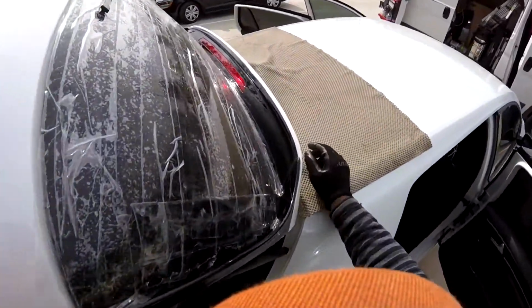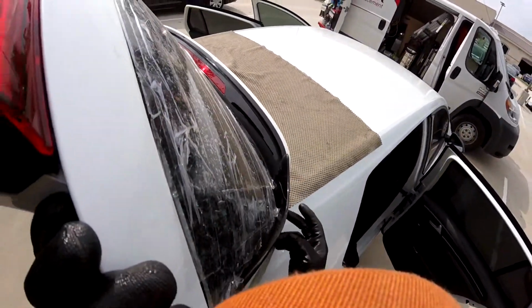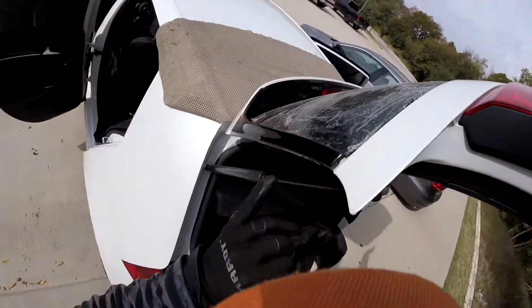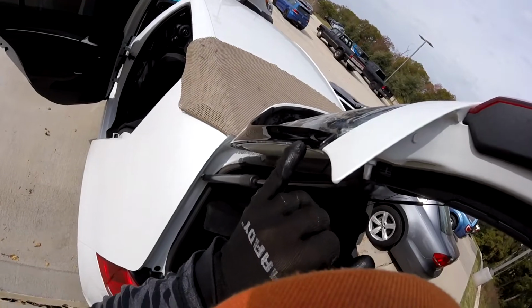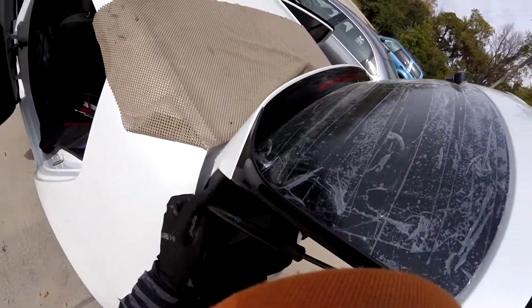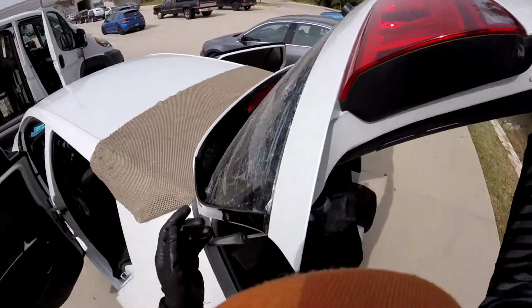Usually the people have to order a new one because the new ones come with the glue. So you cannot use those regular 3M double face tapes because it's really thin. If you use one of those, it's gonna be higher, so it's gonna look bigger in this area. So that's the problem. We gotta reuse the same one or go with new parts.